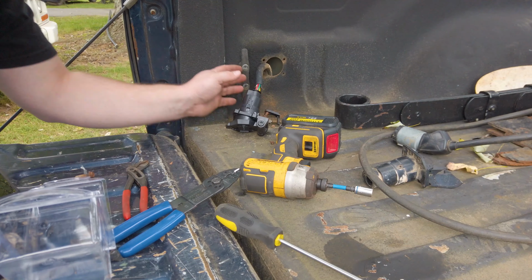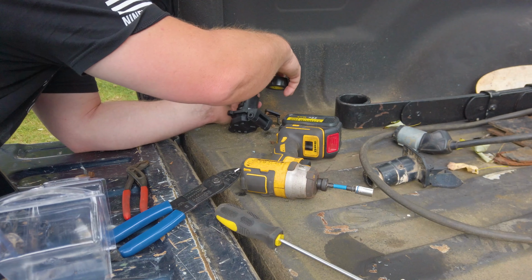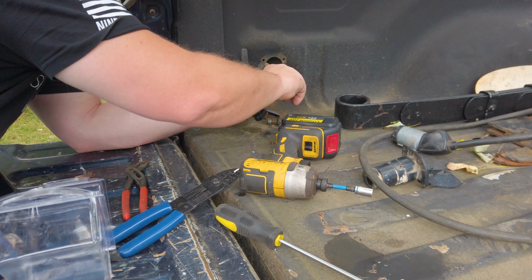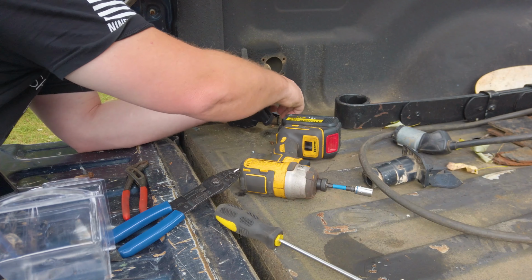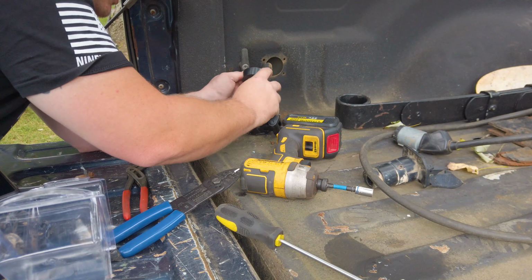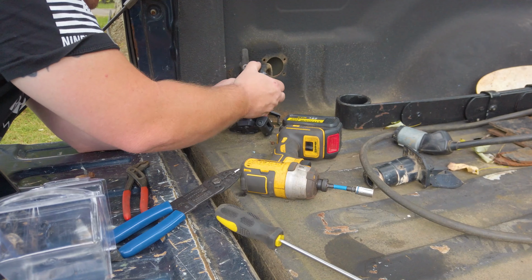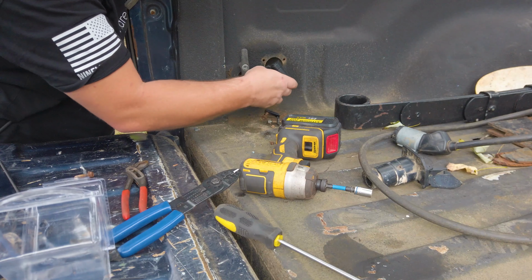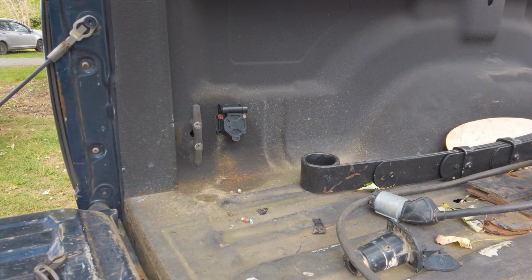We're gonna take electrical tape. This black wire I should check to see if there's power to it, to see exactly why they had cut it off right there, and make sure that nothing funny was going on with it. But anyways, we're just going to wrap this up real good to make sure that vibration and stuff doesn't come back to bite us. I usually like to do 4 or 5 rounds, maybe a little more. Just want to really be mindful of that. So here's our finished product. Let's plug it in.